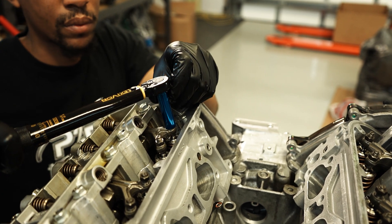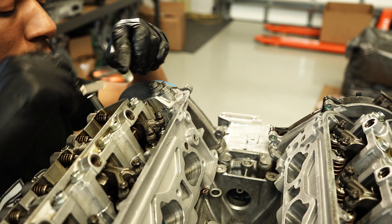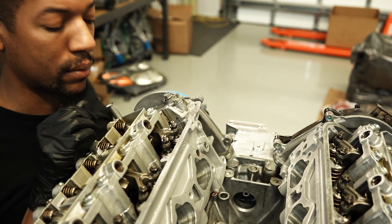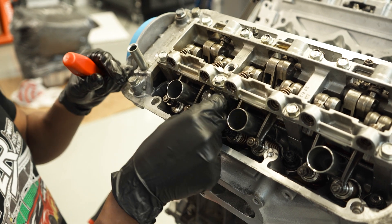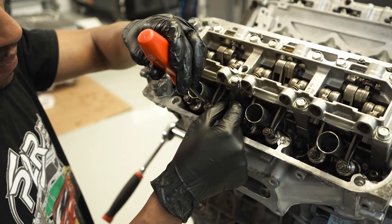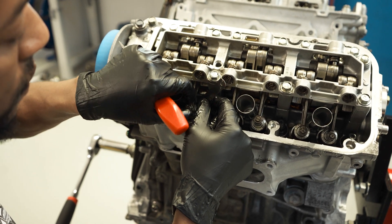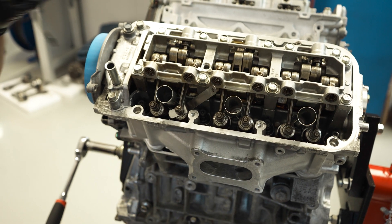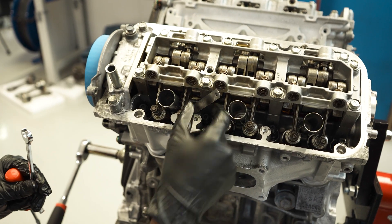Don't get confused when the camera is on the front or rear of the motor. Always make sure you locate the timing belt side versus the transmission side — that way you know exactly which cylinder you're on. In this case we're on cylinder number four. As a quick reference, at the beginning of the video I put the cylinder numbers over the engine so you can clearly see the order Honda is telling you to do. The exhaust side is always a little harder to get the feeler gauge in — there's more casting material in the way. Make sure you're getting the feeler gauge in at a good angle. A pre-bent feeler gauge works really well for most J series cylinder heads because it allows you to go down into the head before it bends.